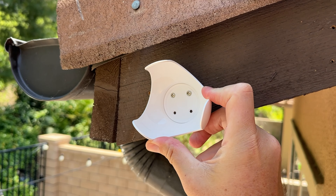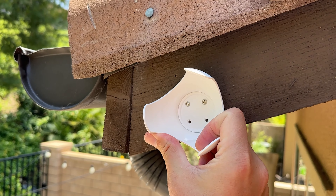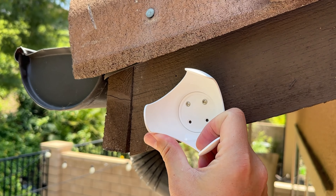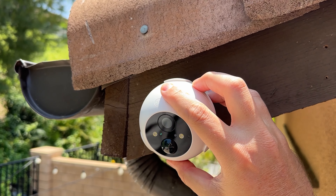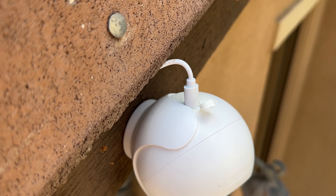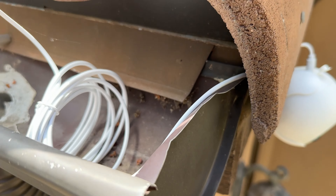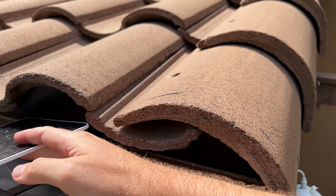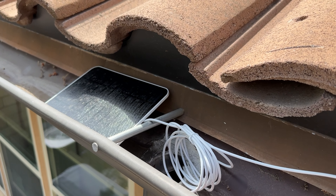Now that we've got the camera set up, I'm going to go ahead and install it outside. I have the mount screwed in — I only used the two top screws. I noticed that if I didn't put the screws in too tight, I could still turn the mount and get it in the position I want. Now that the mount is installed, I just slip the camera in and position it using the live view on the app. We also have the addition of the solar panel — I just plug it into the little door on top of the camera and either set it on my roof or in my gutter. I prefer the gutter so wind doesn't blow it off. That gives it plenty of sun to keep the camera topped off.